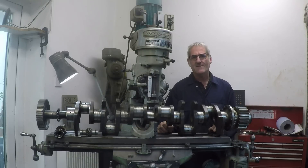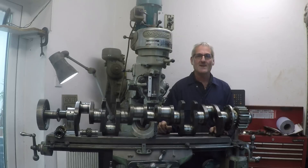This term refers to the failure of the gear drive to the common shaft driving the two magnetos on the engine. Although for redundancy they use two ignition systems, they are both coupled to the same shaft. In the summer of 1942 they started to see more of these failures, and a lot of them were experienced by Spitfire test pilot Alex Henshaw, who writes about it in detail in his book called Sigh for a Merlin. In this video I'm going to go through the lengthy process by which they worked out what was causing the failures and how they went about putting it right.